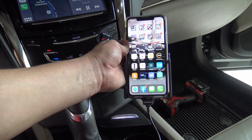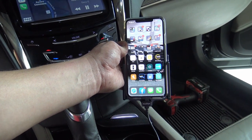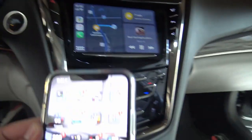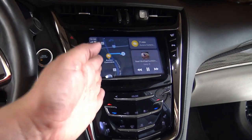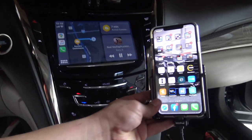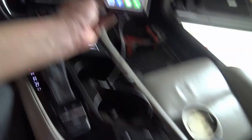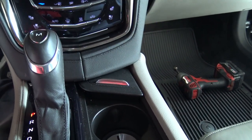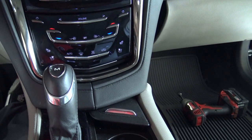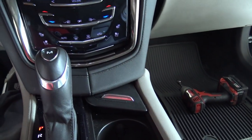This is going to sit right here. It's charging the phone at a 50% faster rate than the original equipment USB connector would have done. I've got Apple CarPlay, and the phone is mounted right next to the radio. Now I'm going to drill a small hole at the bottom corner to run the wire through, then through this side I left open for the ProClip mount. You won't be able to see any wires — just the small ProClip mount wire showing maybe that much.